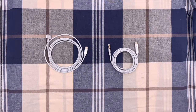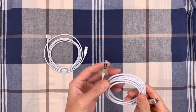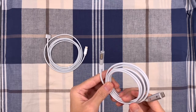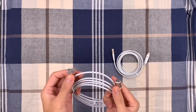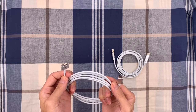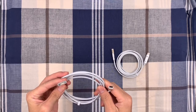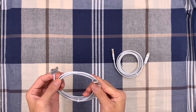Let's talk about compatibility. The MagSafe 1 L-tip fits MacBook Air and MacBook Pro before 2012 — it does not fit models after 2012. The MagSafe 2 T-tip charger adapter is compatible with 2012 to 2017 MacBook Pro in 13-inch, 15-inch, and 17-inch, and MacBook Air in 11-inch and 13-inch. It supports USB-C power adapters.